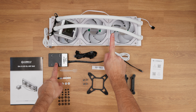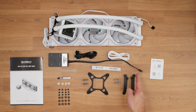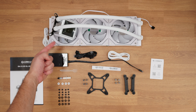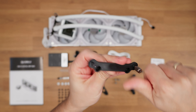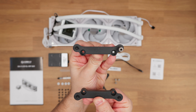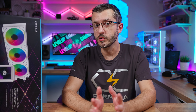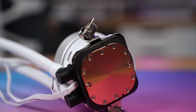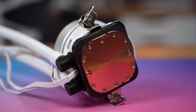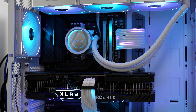To break it down: what's in the box? Screws and washers for the AIO mounting, thermal paste, SL Infinity controller, and Intel CPU backplate — which is not good. But check out the AMD mounting hardware: as bad as the Intel one is, the AMD mounting bracket is spot on and literally two times better than the solution the original Galahad 2 had. They are using offset mounting holes but still using the four holes of the AMD backplate. By offsetting the mounting holes they are using the same spacing as Intel, which gives better pressure and coverage of the AMD CPU. The original Galahad 2 used stock AMD brackets, and that solution doesn't provide adequate pressure on the CPU itself, so AMD CPUs were always cooled worse with that mounting method.